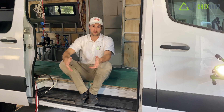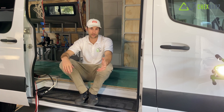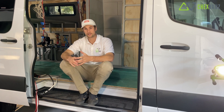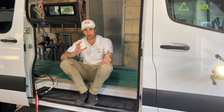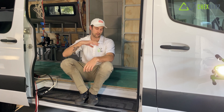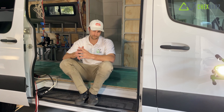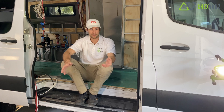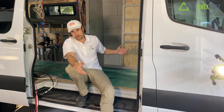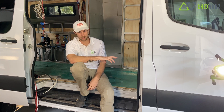Also think about the capacity of your fresh water and your gray water. Here in the 144 we have a 28-gallon fresh water tank that sits in the spare tire carrier, a 20-gallon tank on the driver's side for gray water, and an 11-gallon on the passenger side for gray water as well. The reason we have those tanks that way is your shower is obviously going to use more water, so we decided to have a larger capacity tank on that side.